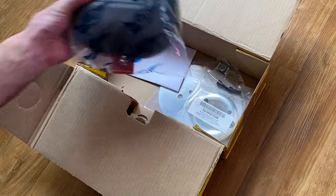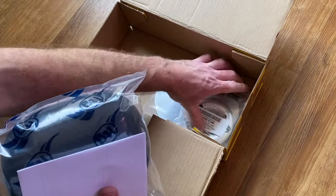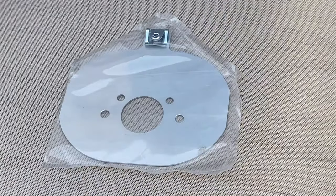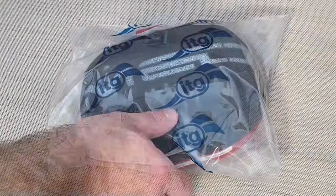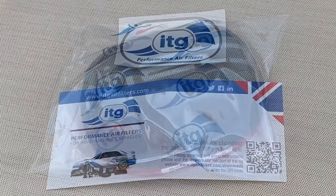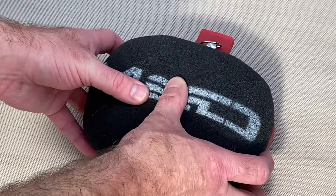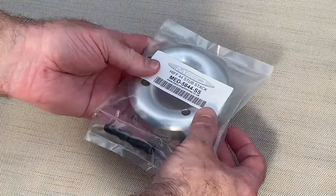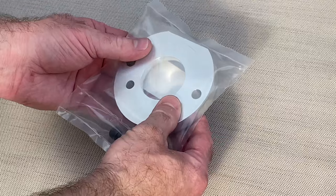If you've never seen one before, here's what comes in the kit: a CNC machined aluminium stub stack — this one being for the HI-44 — a laser cut aluminium base plate, the MED branded ITG foam filter, and all the required fixings to fit it to the carb, plus a card and a sticker. They've bench tested the kits and found airflow to the carb has improved, resulting in performance increases. I think this is due to the combination of the stub stack design and the open-backed ITG filter.